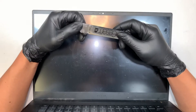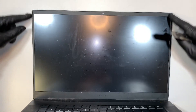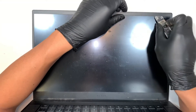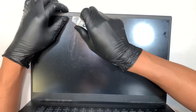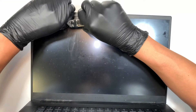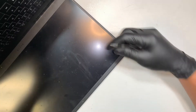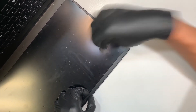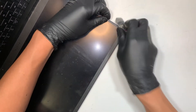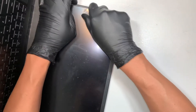I'll be using a metal prying tool. First we need to remove the bezel. The bezel is pretty much held on by double-sided tape — it's kind of glued on, so we need to cut it in order to get to the screen. Get yourself a metal prying tool and slowly work around the bezel. The bezel feels somewhat like aluminum, it's not plastic, so if you bend it you'll have an ugly permanent bend. Take your time slowly and just separate that adhesive tape.